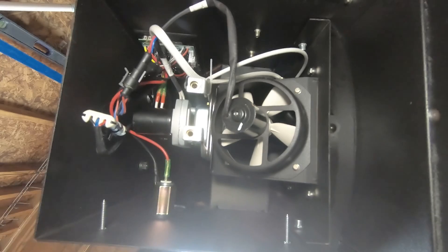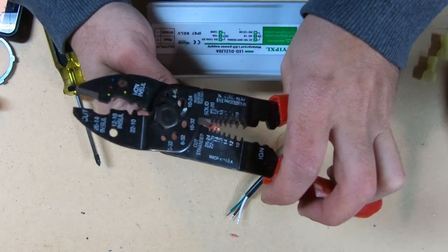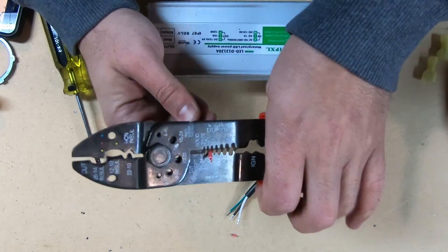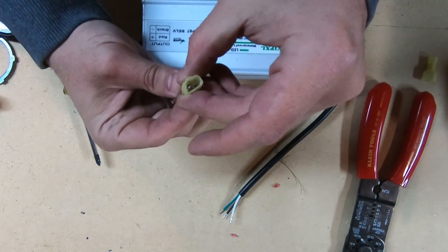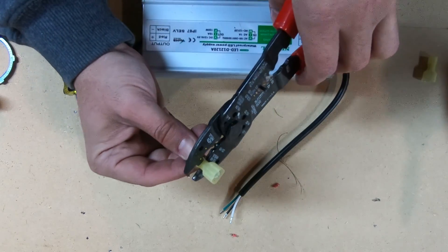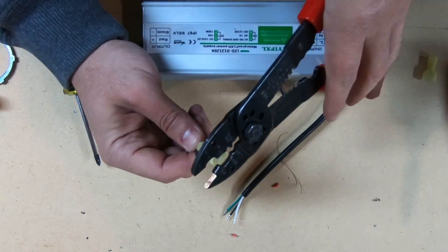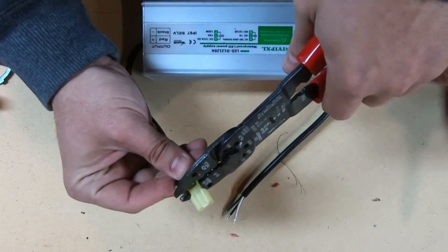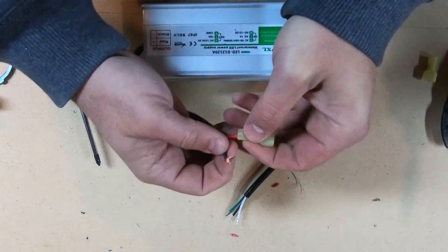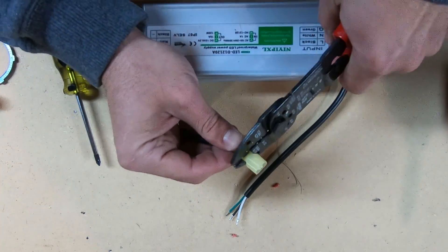Here I'm just pointing out the 12-volt hot and ground on the inside — that's what we're gonna tap into. And here we're just putting the T-taps on the DC side of the connection. T-taps are pretty simple; it's a mechanical fastener just like any other crimp connector. You slide the tap on, get your wire nice and in that hole, and then crimp it down. I think T-taps kind of suck — it's just what I had on hand. I will change these out for posi-taps later, which is a much cleaner, easier-to-install connection that I think is just all-around better.